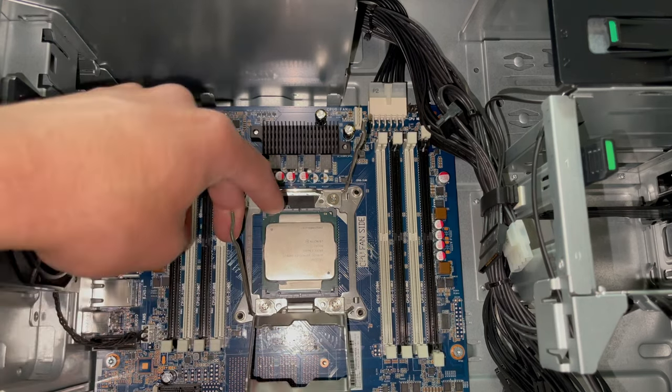And we're going to make sure under boot options, fast boot is disabled. I'm going to remove the POST delay, but that's not really necessary. Legacy, I'm going to go ahead and disable that. Again, not necessary, but just something I want to do. All right, so we got all that squared away.